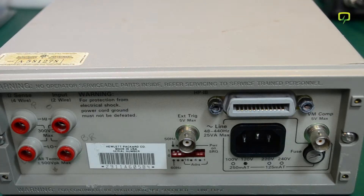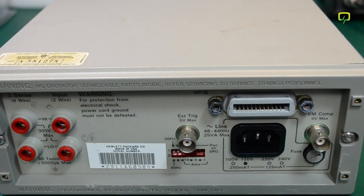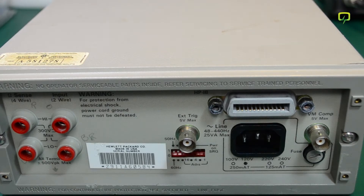The unit seems to be rated for 110 volts input because it comes from the United States, but according to the service manual it should have a gray wire on its transformer inside for voltage selection, and I should be able to easily change it to 220 or 240 volts — but I'll have to do that in a future video.